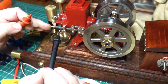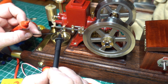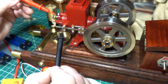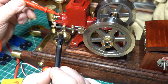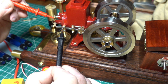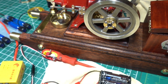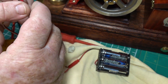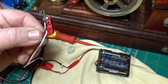Just one more question while I've got you. I'm touching the probe on the earth wire - not the screw, but the round part that's soldered in there. Touching the probe on the spark plug, touching all the metal parts - yes, I'll take that as proof that's a good earth. So I've got good earth, but this wiring issue has got me beat.